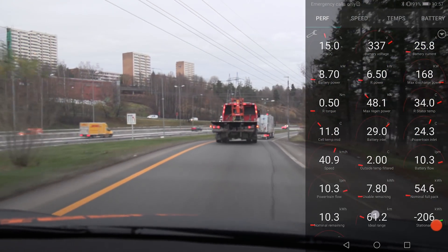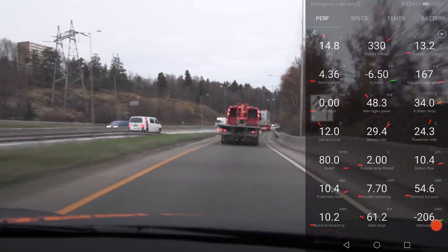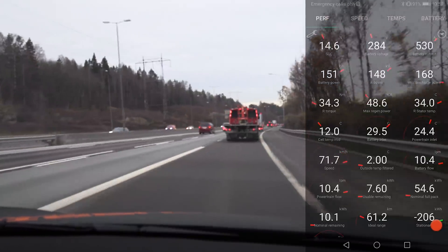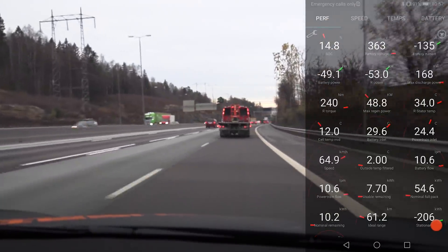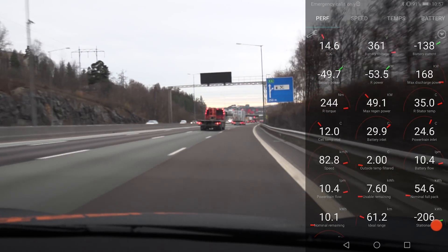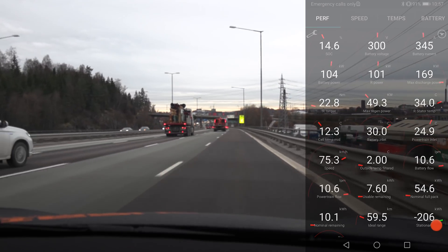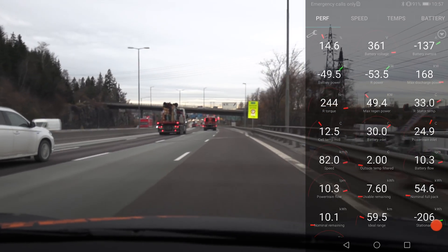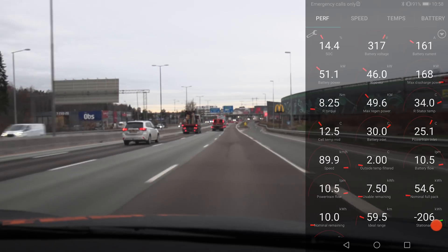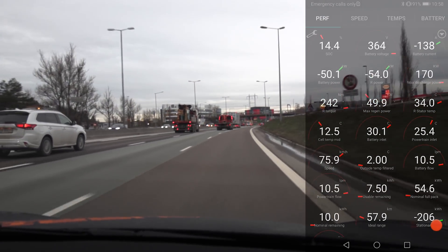After all I have 61 kilometers of range and plenty of power. But you can see here we are taking 49 kilowatts of regen — how is that possible when we could only charge at 12-13 kilowatts? This is burst power. The car allows higher burst rates, but for continuous power it has to be lower — that's probably why we received 20 kilowatts initially and then it dropped. Every time we regen it's only for a couple of seconds, so higher burst rates are allowed.